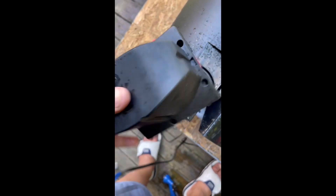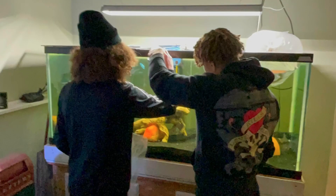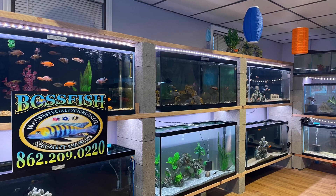Don't do what I did and push it in upside down. Make sure you line the holes up correctly and screw them back in — not too tight, just tight enough. You don't want to strip the inside plastic of the canister. Once you do that, get all your media back in, make sure you fill the canister up before you plug it in — it does not self-prime. I hope this video was helpful, see you in the next one.